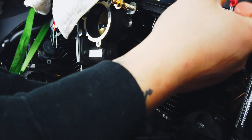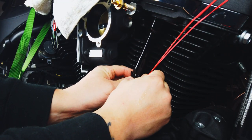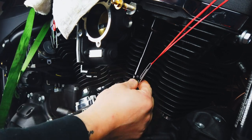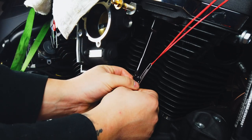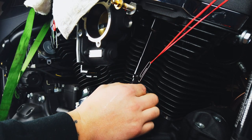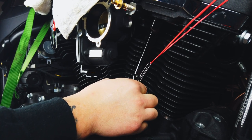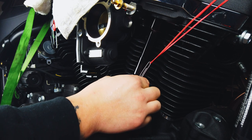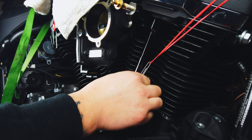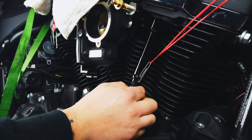And you'll want to do the trick that I mentioned earlier. Some paper clips, just connected right onto there, to hold these up. Alright. So I get it just so that it's touching the lifter. I want it basically so that it's loose in there, right? It's loose. Like it doesn't feel tight. You can still spin it, but you can't move it up and down. You can kind of jiggle it a little side to side, but that's okay.